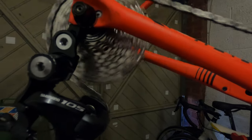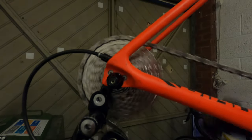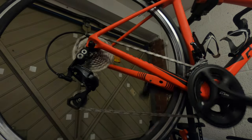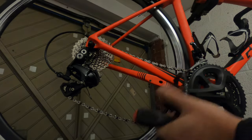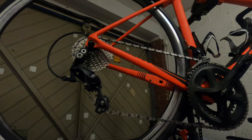So that is great for climbing up a hill - 34 to 32 - and that change is nice. I can't go down the cassette much more than about 4 or 5 gears before I need to go into the big ring at the front, as the chain gets too loose. So I can't really take any more links out of the chain. The chain is sagging there - I don't really want to go any more than that. It's not indexing quite as well, and that is the limit of the derailleur - it won't allow me to index into that top gear.